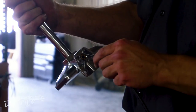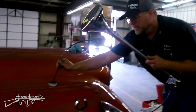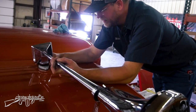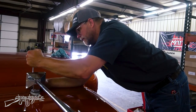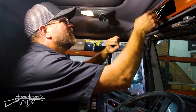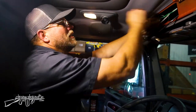These horns have a quarter-inch airline quick-connect built in, so I'll plug the line right into that fitting, give it a tug to make sure it's attached, and feed this end through the channel in the roof — so it won't be poking around inside the headliner. It follows that channel right to where I need to go. I'll put in the two mounting bolts in the rear and tighten them down — last time I'll need to mess with it up here. Now inside the cab, the airline lines are through the roof.